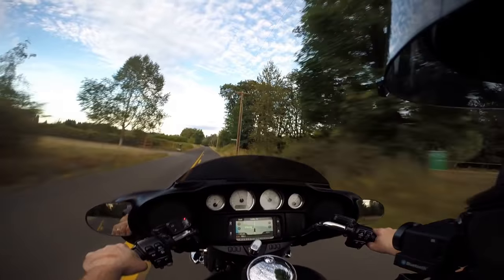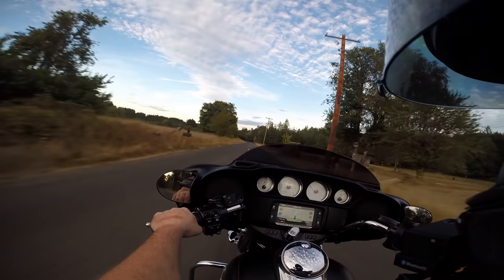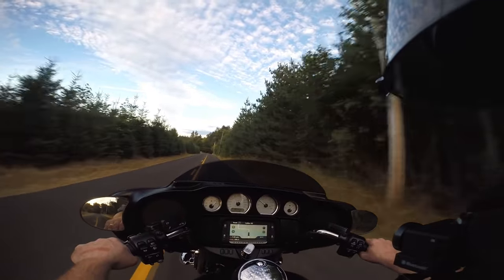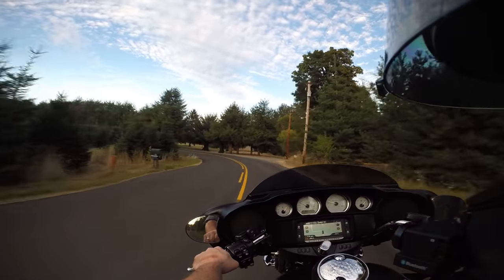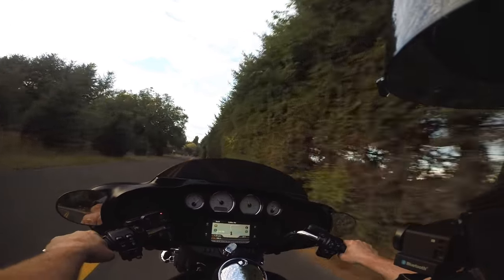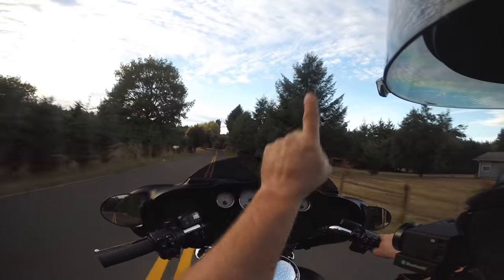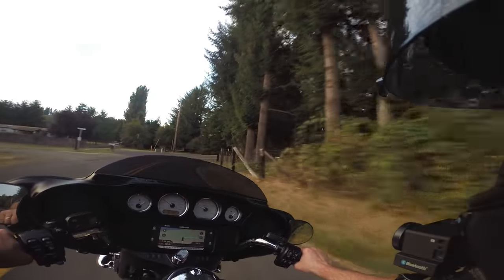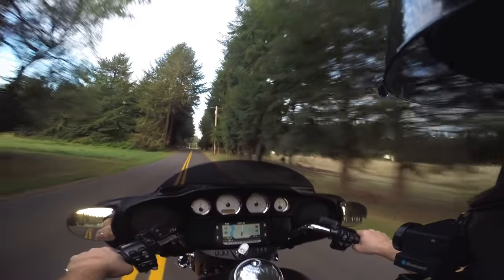Not exactly the smoothest road right through here. I know driving through here, you'd normally get a lot of shake in my voice, even with that. So I think maybe our initial test may be good. I do need to check that sag, though, with my full weight on it, and get an idea of where I'm at. I don't want to be halfway or something like that, which I'm pretty sure I'm not, but I could be. I think it's got, was it 12 or 20 turns? There's a huge amount of adjustment in these things. And I may have them just way soft, and my sensation of being squatted is more than just a sensation.